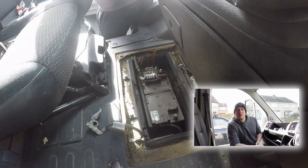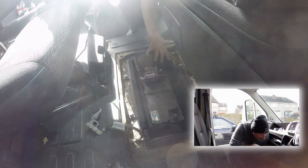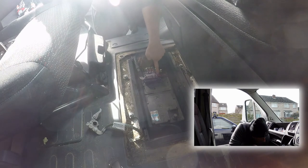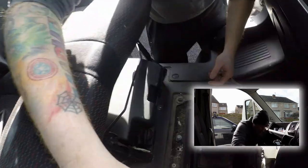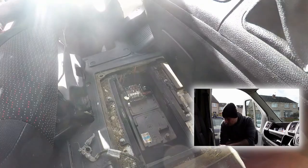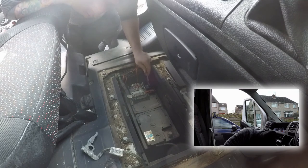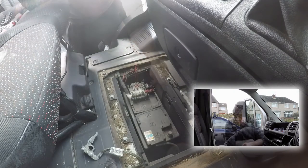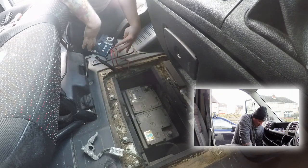The next stage is where your Phillips screwdriver and your 10mm socket come in handy. On this panel there are usually two Phillips screws which you would need to unscrew to release — though for some reason there weren't on mine. Then down in this corner there's a nut that needs to be removed. Once you've unscrewed that nut a little bit it releases the pressure so you can take off that panel, which frees up the battery.